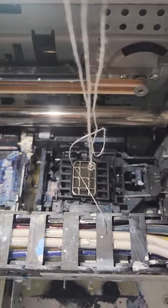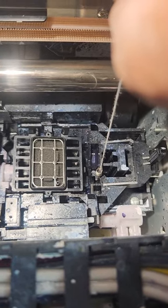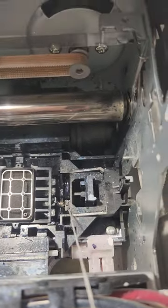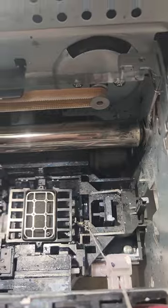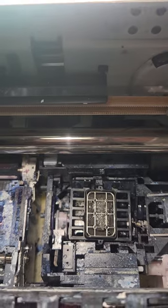I'm gonna put the camera down to do this. You can see the spring is hooked on this little latch, and I'm holding my string and going to hook it on the other latch. I was able to fish that on up and then just pull the string on out — and there we have it. I went ahead and wet the pad a little bit, and I'm gonna go ahead and turn my machine on. This completes the process of changing out our ink pad.